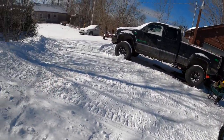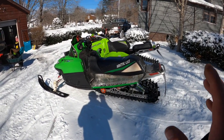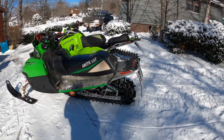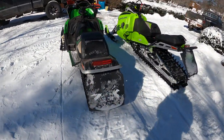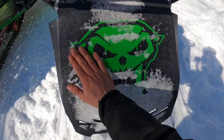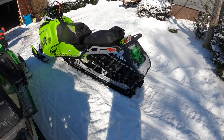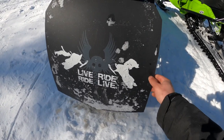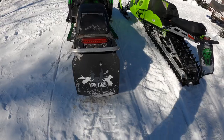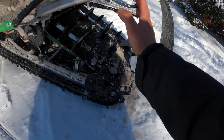These last few years with lower snow amounts, and a lot of times we get rain, you're driving over a lot of hard-packed surfaces — not nice fluffy snow. I've been in situations where this machine flashes the temperature light, not hot enough to hurt it, but it's letting you know it's not happy. PDP Products — which I got off Amazon — makes these nice aftermarket snow flaps with all kinds of different logos. They're quite cheap, you can bolt or rivet them on, and they're made of a super durable material. I've had this one on for a few years and it's holding up great. With the flap and the coolers in the back, you get a lot less overheating issues because snow coming off your track gets directed right up towards them.